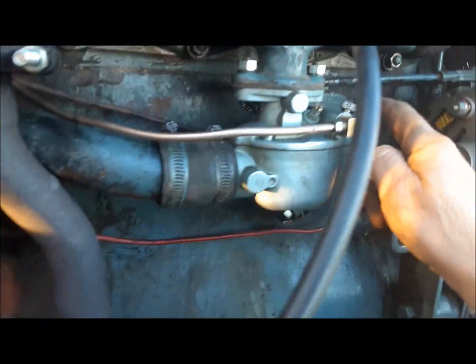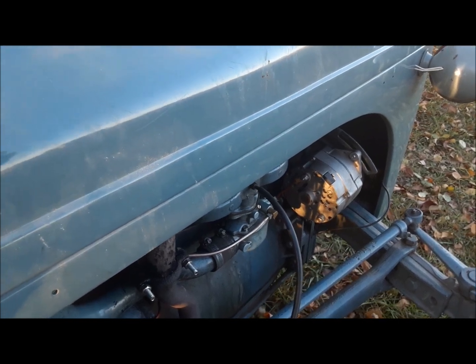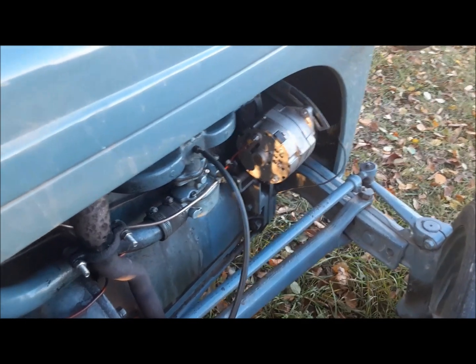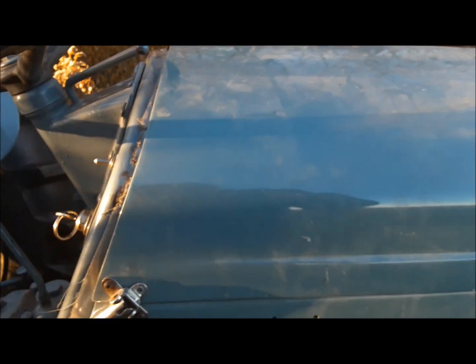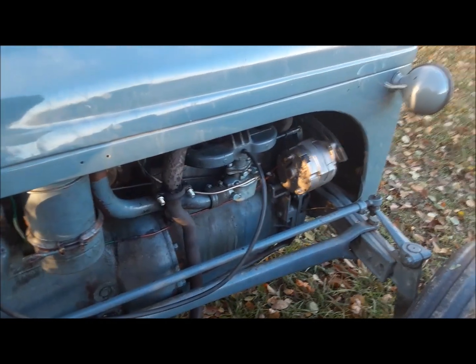So here we are in the back 40. Our power screw needs to be adjusted properly. And it takes off pretty well like that. That's pretty good. I mean, you can open it up a little bit more, until you just get rid of that stutter when you open the throttle. Right there. Now, if when you're using it, you see it puffing out black smoke when it hunkers down, or you smell it, you could close that screw back a little bit.